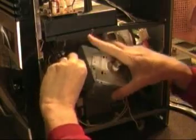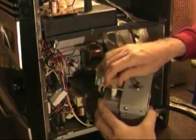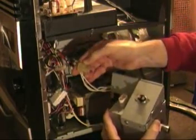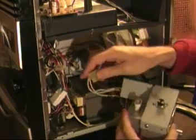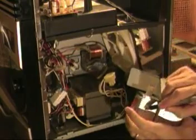You can take the connectors off the thermal sensor — they're not polarized so it doesn't matter which way. I pulled one off and wasn't sure if it was polarized, so just to make absolutely sure I took a Sharpie and put an up arrow on it so I'd know how to put it back together. The magnetron is out, and I labeled it too just to make sure I didn't accidentally put the bad one back in.